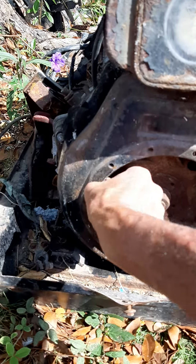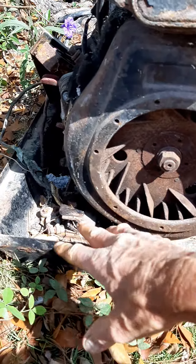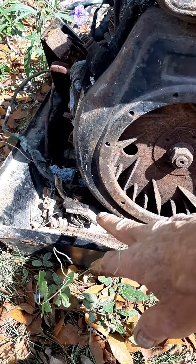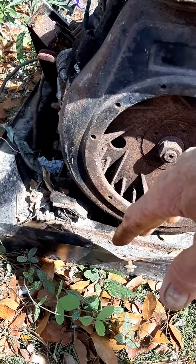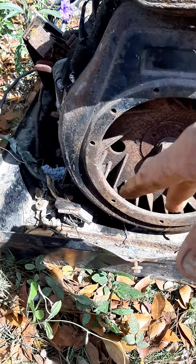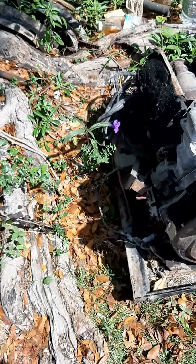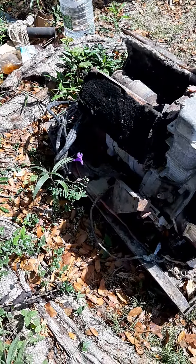It can turn, but something is hitting inside, so I'm going to investigate that. First I've got to take it off of the framework, then remove the generator from the engine, and then open the guts and pull the head off. Regardless, I don't see a hole in the cylinder, so there will pretty much guaranteed be usable parts on this even if I can't get it all running again.